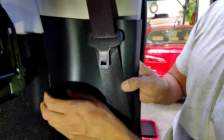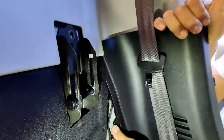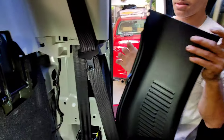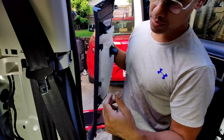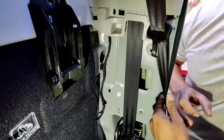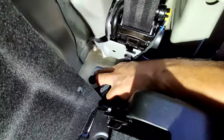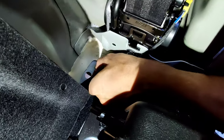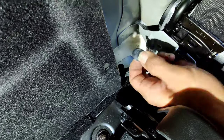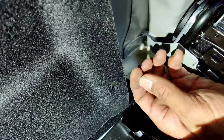Pop it from the top like that. Feels like there's a clip up here holding it — clips just fell off, we'll put that back on. Just the panel lock — they've even got a bit of insulation there to stop the noise from coming in from the boot. Then we've got a grommet down here. So this grommet here, we're going to actually pop that off — and there's our access hole. I'd recommend drilling a hole in this and pulling your cable through there so it doesn't get cut on the metal. That goes straight down to the bottom, so I'm going to drill this now.